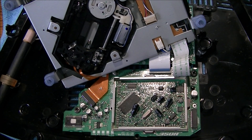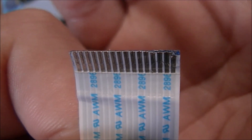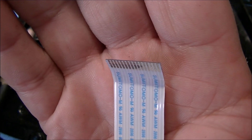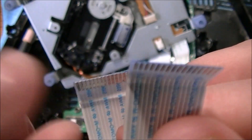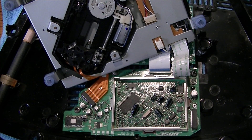I'm back to square one. I checked the ribbon cable that goes to the display. Although there is a slight bit of damage up in the corner, I can get it to insert far enough that it shouldn't be causing the non-working display issue. The other side, which connects down under the CD player to that board, is in impeccable shape. I tested wire for wire, strip for strip, and everything is making connection - there is continuity.